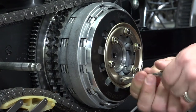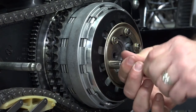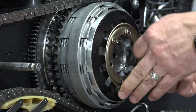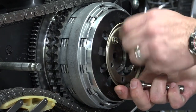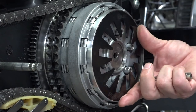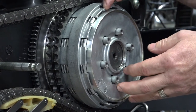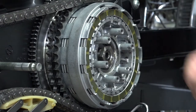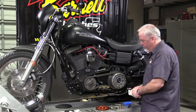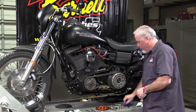Start at the bottom and get the bolts out of the way. You're not going to reuse any of these pieces, so set them aside. Our new pressure plate comes with a new retainer, coil springs instead of the diaphragm spring, and new bolts. Hold everything in place so it doesn't fall out. You've got the retainer, the diaphragm spring — which we're not using anymore — and the cast aluminum pressure plate coming off. Keep a finger on the top plate so you don't pull all your clutch plates out at once. This is also a good time to inspect and measure your clutch plates.